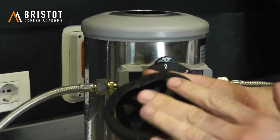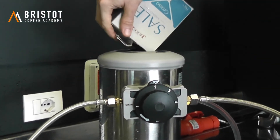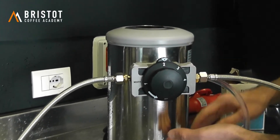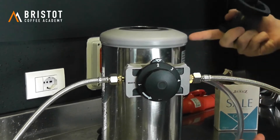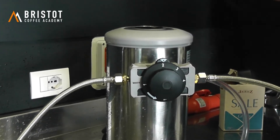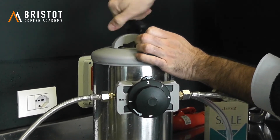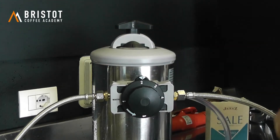Usually there are still some residues of salt or membrane left, so everything needs to be clean. Then we take the salt and put it back in. How much salt depends on the size — the instructions will say, but usually one kilo should be enough for this size of water softener. If it is the bigger one, six to eight liters, and if it is the 12-liter one you will need one and a half kilos. After you've done that, close it and put the lid back on firmly — but try not to close it too firmly, otherwise you'll break the handle.